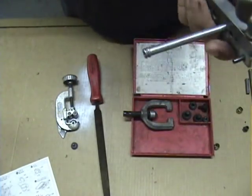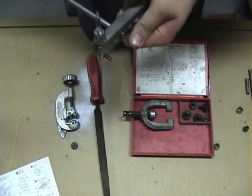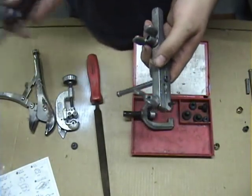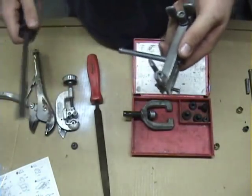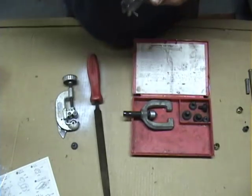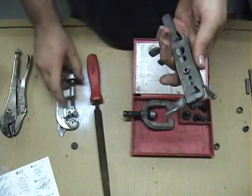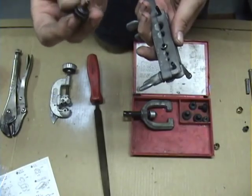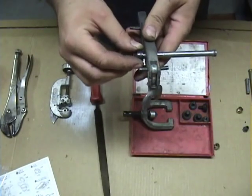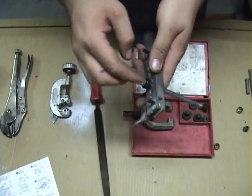Never mind the fact that it looks like crap. It's just easier to do with vice grips. You could also stick a screwdriver or a pry bar in here — I have a pry bar handy, you could tighten it up that way too. Either way will work, but I find that vice grips or water pump pliers work better. Once you've got it nice and tight, take your appropriate size adapter — in this case 5/16 — put the pin in the hole, and make sure you're seated up nice and square in the groove.